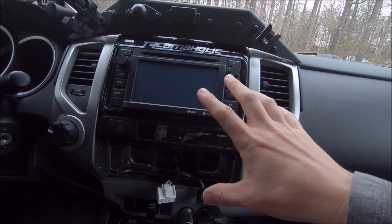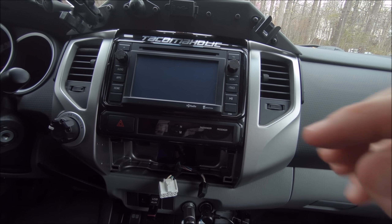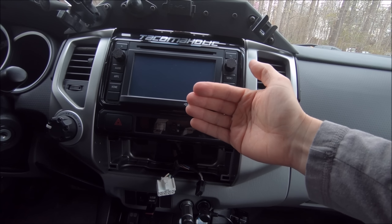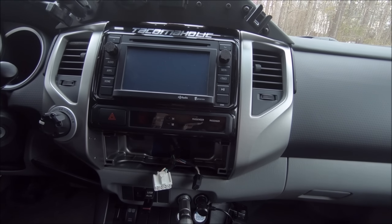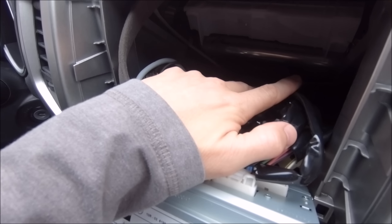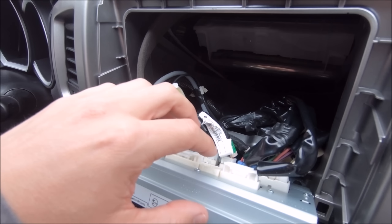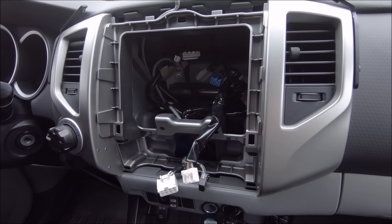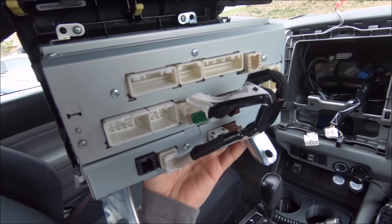Once those four bolts are removed, the entire stereo will be able to be lifted out. When you pull this out, don't forget to remove all of the electrical connections on the back that are wired on the inside of the truck. Some of them you'll see once you actually pull this free. Some of them are just attached from one side of the stereo unit to the other — you can leave those the way they are. Here's a quick shot of the back of the head unit — you can see all the stuff being fed right here from the wrapped wires. Just follow that to where it connects to the back of the head unit and disconnect those. And there's the mess of wires left behind, including the long wire for the clock on the bottom — don't forget that.